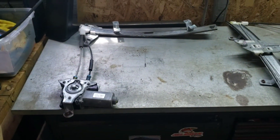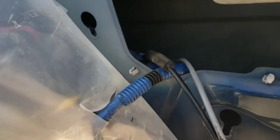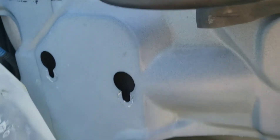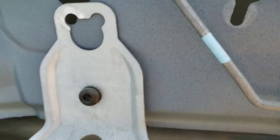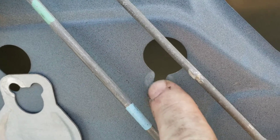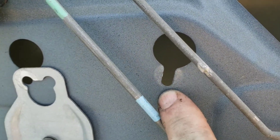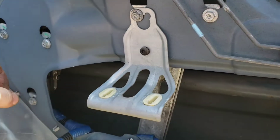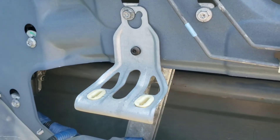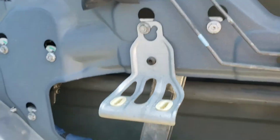I've reinstalled the clip back onto the motor. The long bolts are what hold the track in place, and the shorter bolts are what hold the motor. Simply use the witness marks to reinstall it in the right spot. Once I get that installed I'll come back and show you how to get the motor in. Now that I've got all the motor bolts and track bolts reinstalled on their witness marks, I need to plug back in the power window switch and lower the window to an easier position to reinstall the bolts.